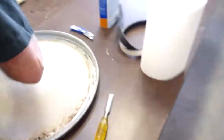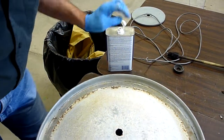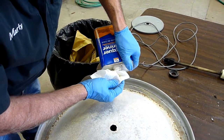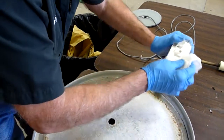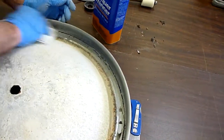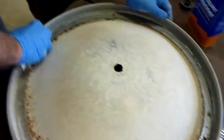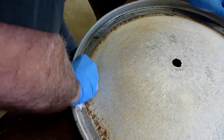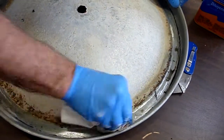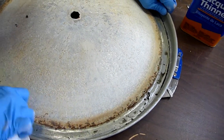Make sure there are no ridges by removing them with a putty knife. Use a solvent such as lacquer thinner and a paper towel or rag to wipe away any of the remaining fragments of gasket and adhesive that are left on the rim. Use only nitrile gloves, as the lacquer thinner will penetrate latex or other types of gloves and get into your skin. Continue cleaning until all of the gasket parts and adhesive have been removed.